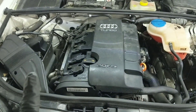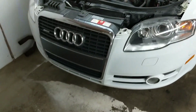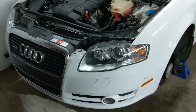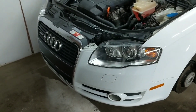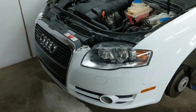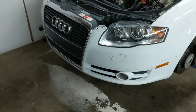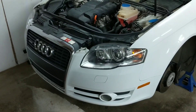Finally, reattach the front of the air intake and you're done — you're sitting on two fresh engine mounts. Congratulations. Of course, I'm not done — in fact this is the start of just another project, a project that's going to get in the way of giving part three to you guys. I will do that soon enough though. This dovetails into my next video — I was going to do a bunch of things on the cooling system, including changing the water pump, so the front end of this car was going to come off pretty much no matter what. My solution to fix that snub mount bracket is to get rid of the front bumper cover, take out the rad support, and dig all the way down to the core support — then either machine in a new bolt to fix this once and for all or replace it entirely. Stay tuned for both of those new projects. Thanks for watching.